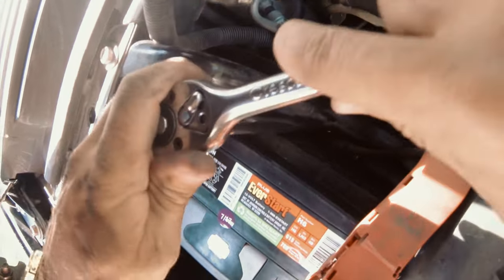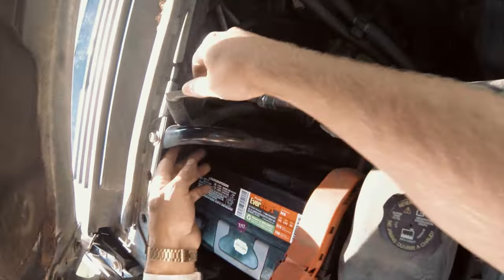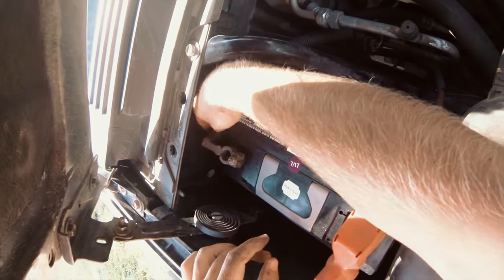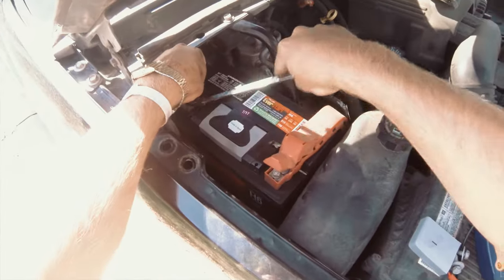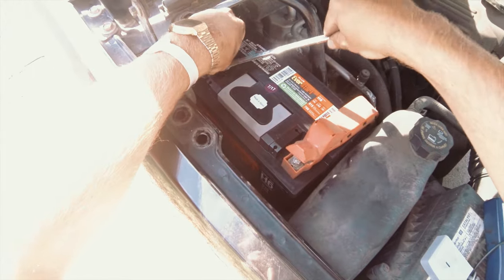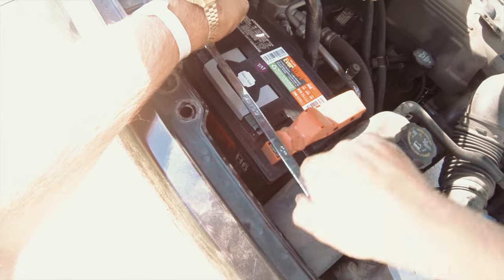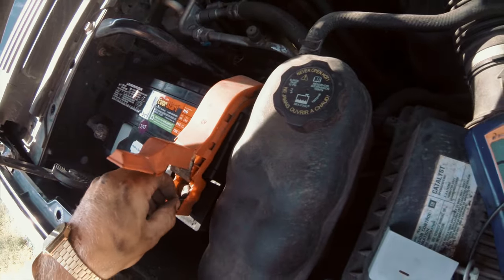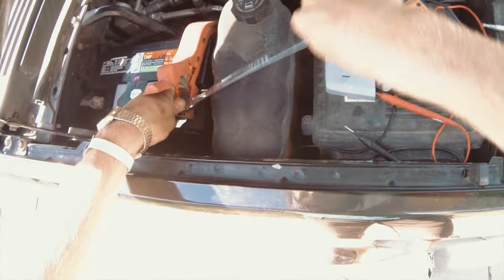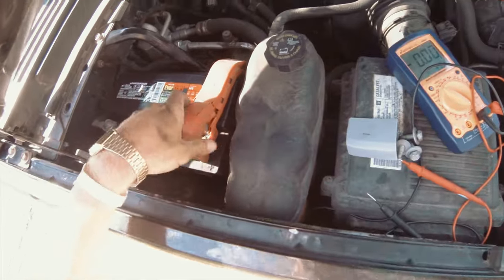You can also get to the bolt from right in here — yeah, that works too. Okay, that's tight. Positive first, then negative — this thing's happy to have juice. Got this super long 10mm wrench, which is amazing. Hand tighten, then ratcheting wrench. Get these pretty tight. If your terminals are dirty it's a good time to clean them — these are quite clean. There's a plastic piece that makes it a little hard to get to with a wrench instead of a socket. That's on there tight.